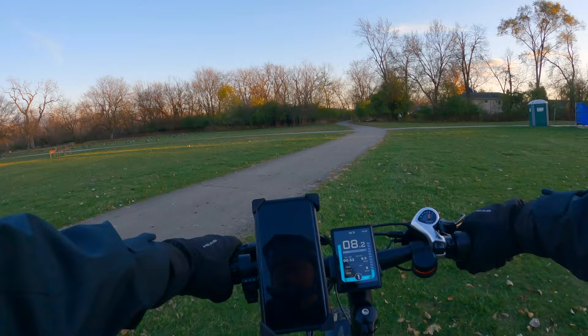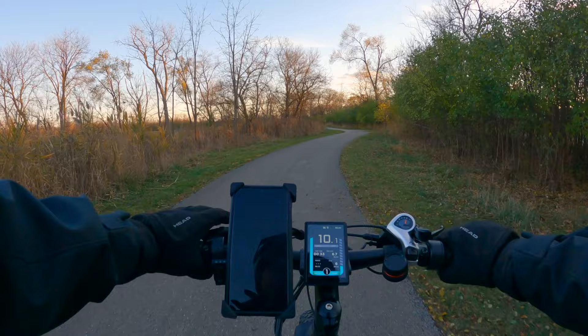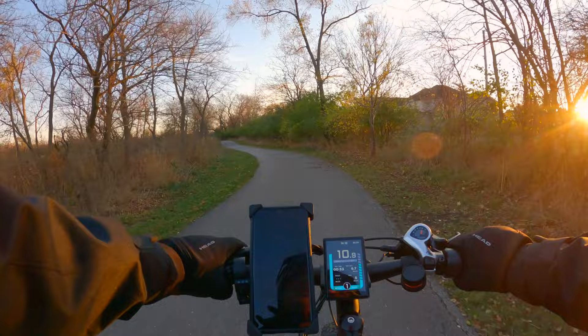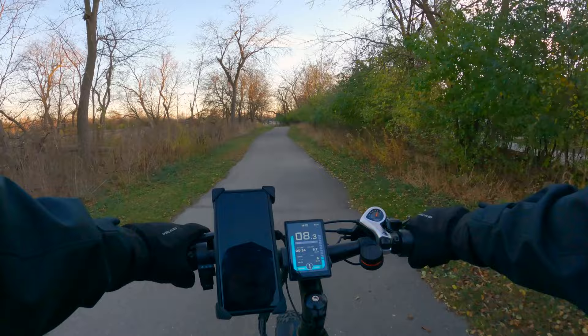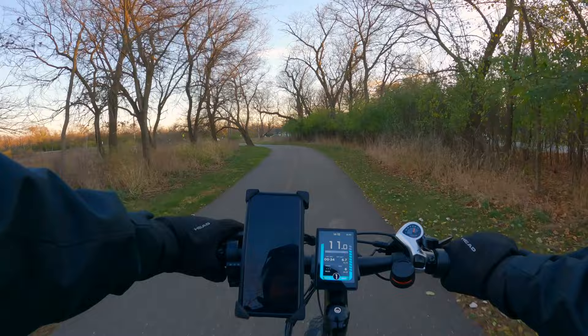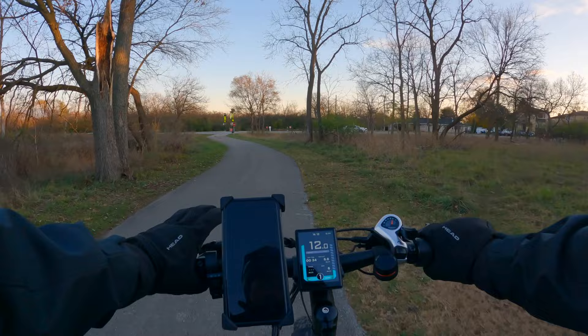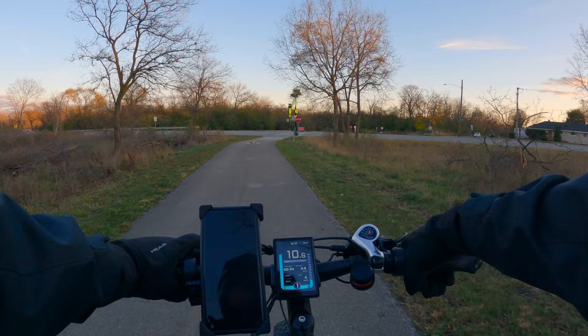It's very cold out, my hands are already going numb, so I'm not going to test the top range. But this is a 20 amp hour battery so I already know it's going to get a good amount of distance — the spec is 40 to 60 miles top range. Based on my experience with other bikes, you're going to get about 40 to 50 miles if you're pedaling casually, and if you're going full throttle at 20 to 30 miles per hour you're probably going to get about 30 miles out of the battery. A 20 amp hour battery is pretty much class leading for most e-bikes right now.